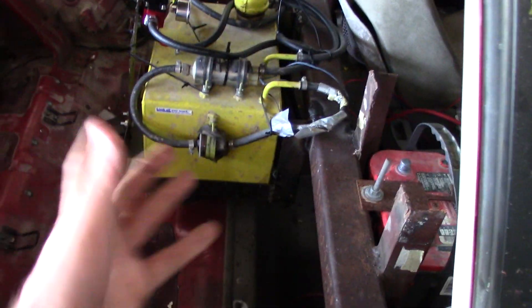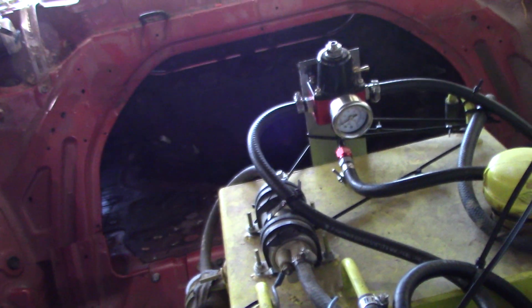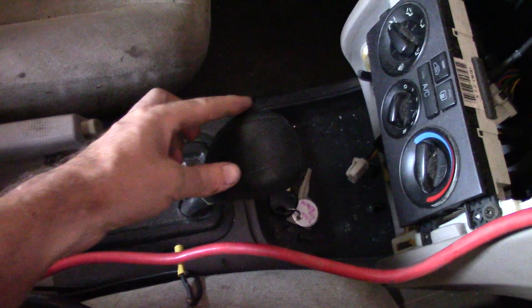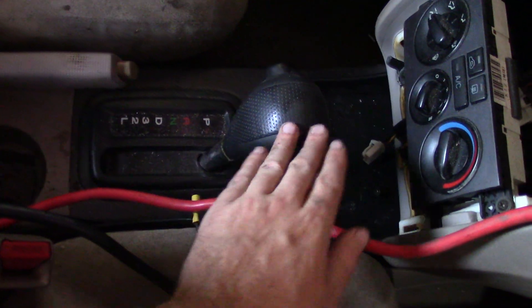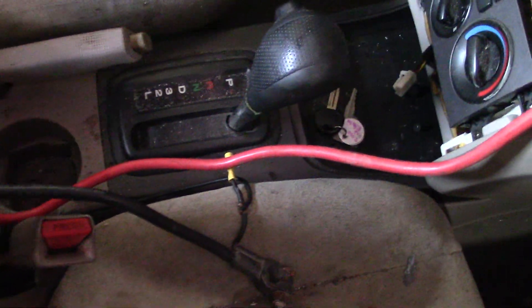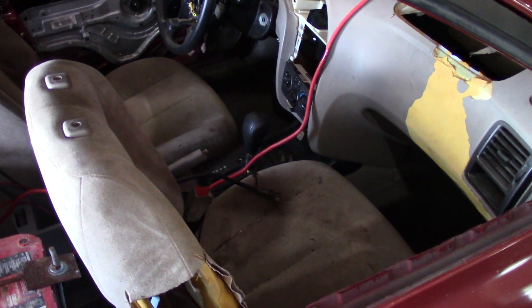The interior is done for these rules — the seat bar is nice and solid, everything is solid for our floating mounts. We ran a switch right here, self-tapped into the center console, so I can reach over and flip it on and off for the fuel pump. I can easily see my pressure gauge from the driver's seat to know if there's an issue during the derby. One more tip: see this little push button on the floor shifter? Before the derby, push that button all the way in and bury it in duct tape so it can never pop back out. That converts the shifter into a slap shifter — you can flip it forward and back through all the gears without hitting the brake pedal or pushing the safety release button, which also prevents the button from breaking and getting bound up.